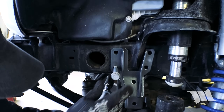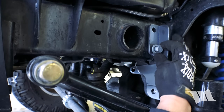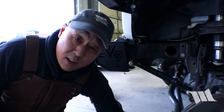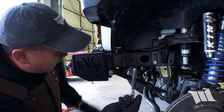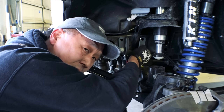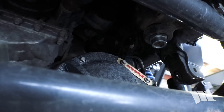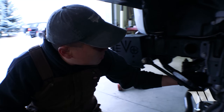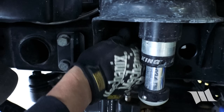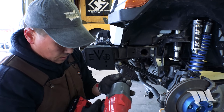So we're going to put this in place, and then we're going to have to lift up the steering box just a bit so that we can get that bolt through it — just threading it in by hand right now. Then we'll take the short one from the back and get that one slipped in next. You might need to jiggle the steering box just a little bit to get it going. Now that we've got those two started, we can go ahead and thread in the rest of the bolts. I'm not going to tighten them yet, just helping them along with the tool.